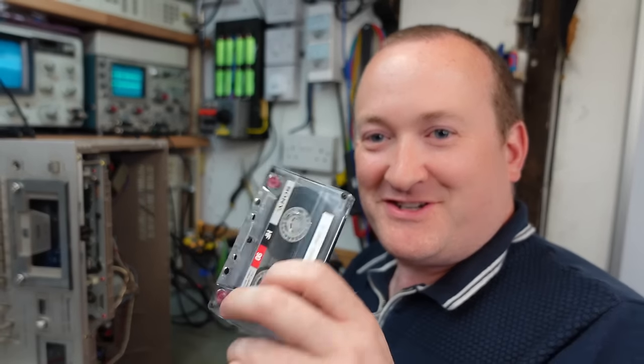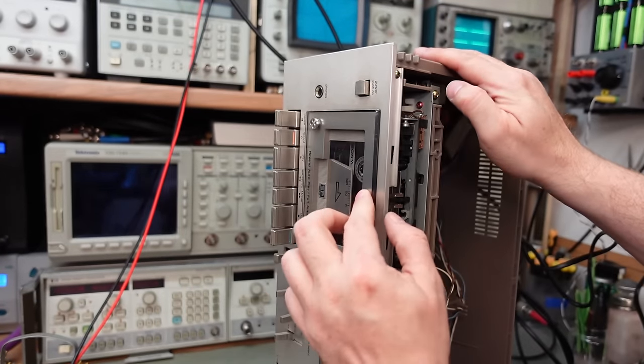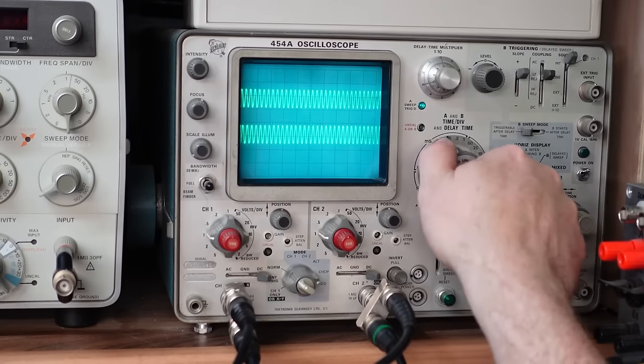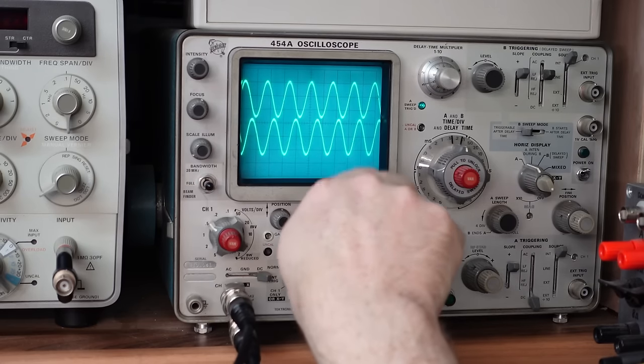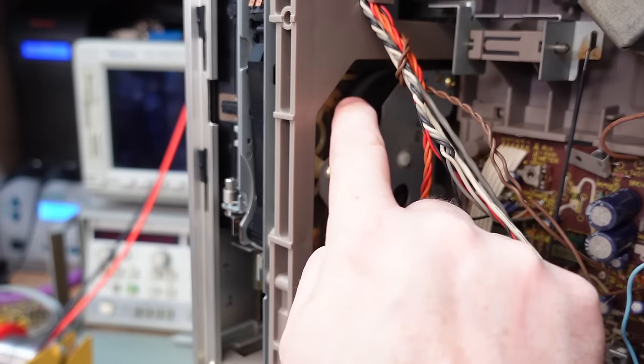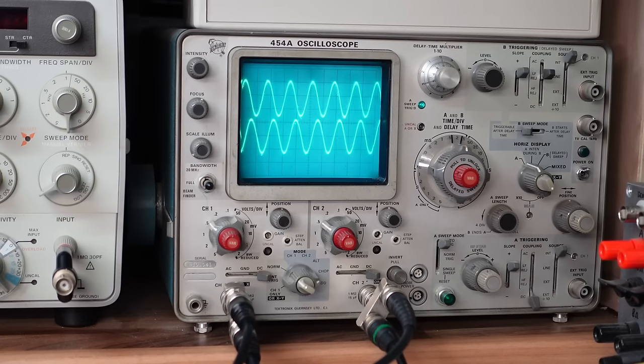The test tape is a continuous tone, stereo 3kHz - it's great for doing analysis on and you don't get copyright infringements. You can just see a little bit of wobbling around on there and I think this is a problem with the belt drive. I'll put my finger on it - it feels a bit rough. This really is a borderline case whether you actually change it or not, depends on the customer if they're bothered. But we'll do it.